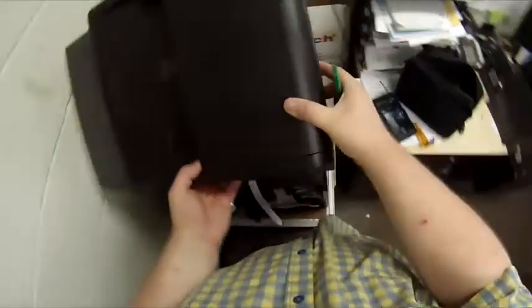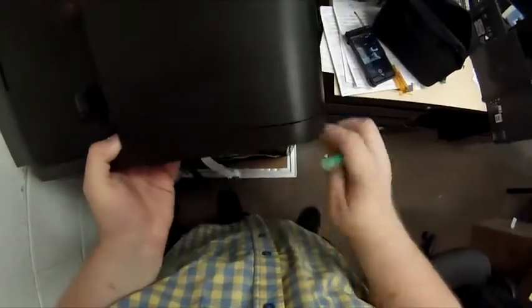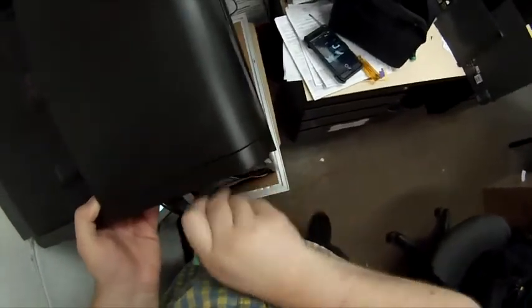I got to get the ADF lid off. So we're just going to open the lid. There's a little cover in the corner here where the cable comes in. I try to do it with my finger, but that just doesn't work. So I'm going to end up grabbing a plastic pry tool. So you see me, I'm getting my plastic pry tool out of my tool bag. It's just a retainer. You're just going to push it back. It pops up a little bit, and we're just going to pry it out. Again, I got fat fingers. You might be able to do this with your hand. I can't. So there it is. Prying on a little bit. One way, another. Just kind of a bad angle. You could pull the lid off, but I don't like to stress cables, so I try to take a little bit of care in this.